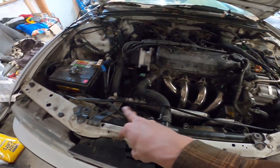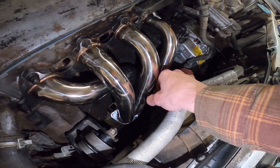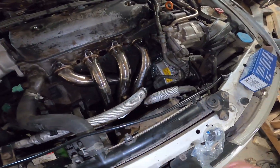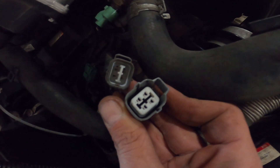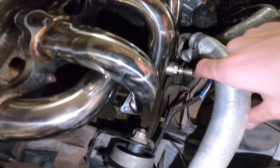Before I start this engine, start warming her up and getting the water pump flowing, let's put this oxygen sensor in real quick. So let's take this plug out real quick. Now let's get this out. First things first — verify the clips are the same. Look the same to me. Second thing second, we should probably put some anti-seize on these threads, but he don't have none and he's anxious to put this puppy together, so we'll fight the oxygen sensor out next time. And then that's in. We can wrap our wire around and then up to here and clip it in. Another simple task knocked out.